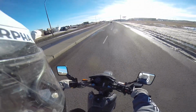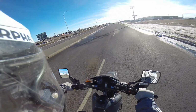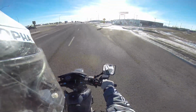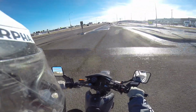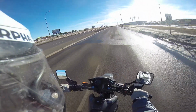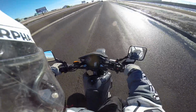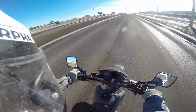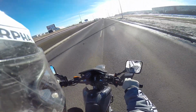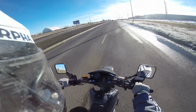But generally, a lot of mechanics that I've talked to like the mineral oil break-in for the first, say, 1,000 miles, which would be 1,600 kilometers for us in Canada. And then you dump that oil out, change the filter, and settle back down.